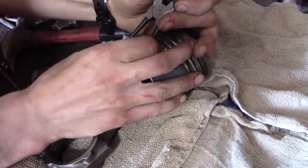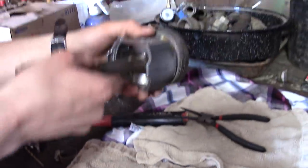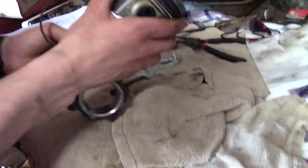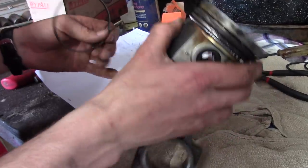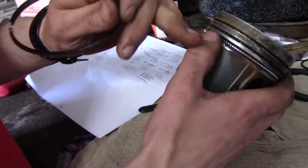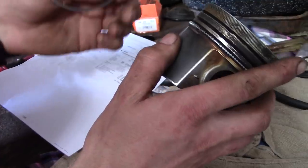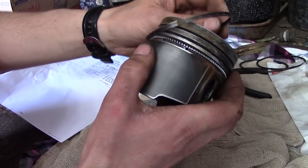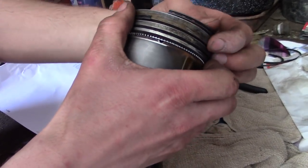Did you have a little oil in them or not? I didn't on this. Did it squirt still up in there? Yeah, it'll get oiled. So now we're putting the rings on. I've got a data sheet here on exactly how they want them aligned in the cylinder. But first I've got the oil ring — I already put the spring on for the oil ring. This one runs a little wire, most of them do, but inside the spring, and it kind of acts like an accordion. Just kind of gently weasel that around.